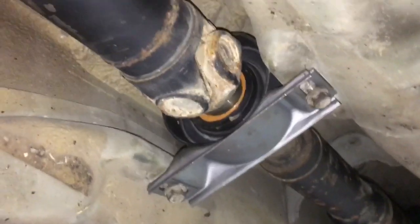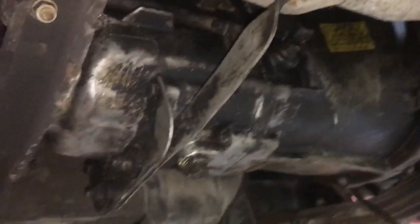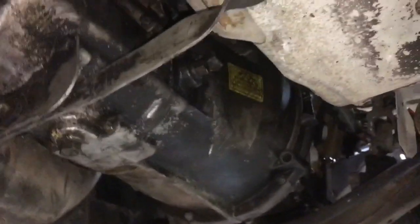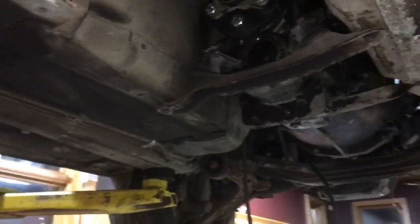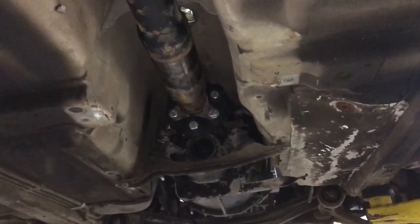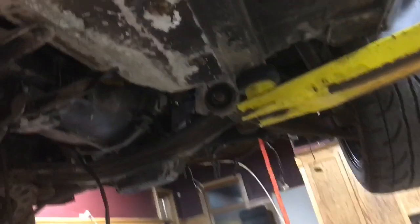It looks surprisingly stock under here — that's kind of just cherry-picking the best parts for everything out of the chassis. You've got a diff from a 325E manual — this one's a good low-mile 2.93. You've got an E36 328 driveshaft with an E30 CSB. GUIBO, standard mounts. Standard really crappy old E46 ZF — I think this trans has like 270,000 miles on it and it's got the fifth-gear lean. The reason I'm using it is because I'm the one driving it, and I'm of the opinion that if that transmission is going to make you misshift, it's going to make you misshift back into fifth, not into third. It doesn't have a lot of value to somebody else, but it shifted really, really nicely.